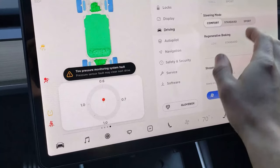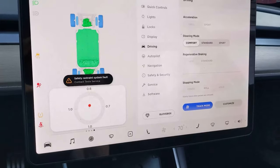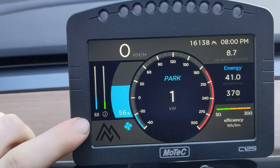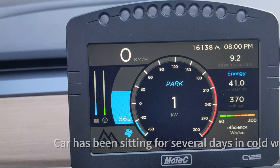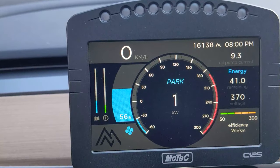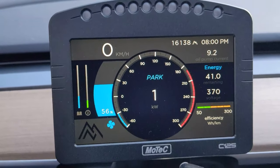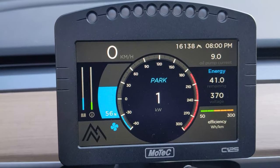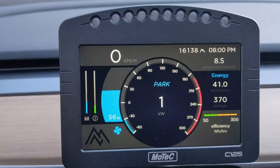It's really important when you're tracking an EV to do a lot of pre-cooling. If you don't pre-cool, there's a good chance you'll overheat quicker than you'd hoped. Right now our powertrain is actually cold and our battery is very close to being cold. We're able to monitor these values in real time, which is really nice. While we're out on track we can see what changes we're making with these cooling modifications, and then review the data afterward to see mathematically over a given time span how much temperatures were increasing before versus how much they're increasing now.